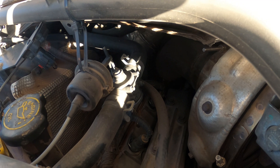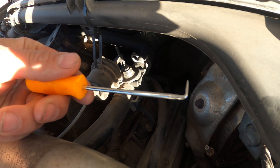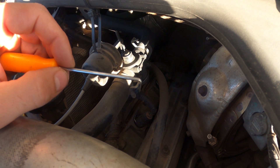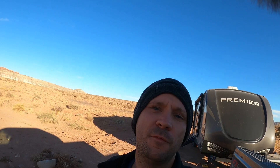If you do have a scanner, that'll be easier to pinpoint where the problem is. The harnesses have a little metal clip on them — you've got to pull that off to be able to disconnect them. Also forgot to mention: you can do a key-on engine-off to hear the injectors buzz, and if you hear something wrong there you can get a real pinpoint location on where to check. Now back to pulling that harness.